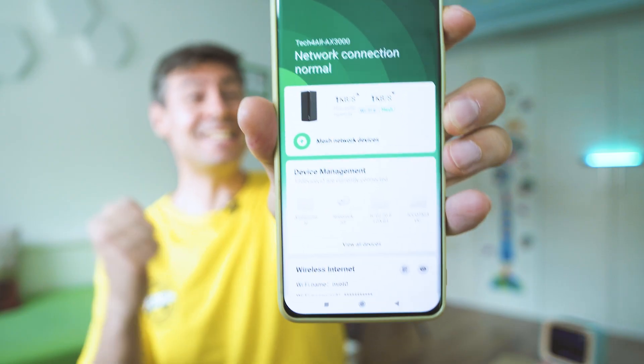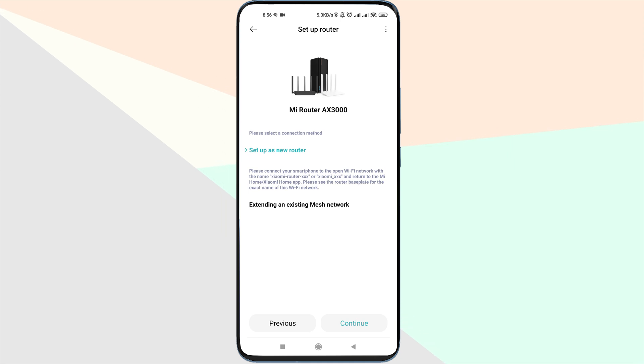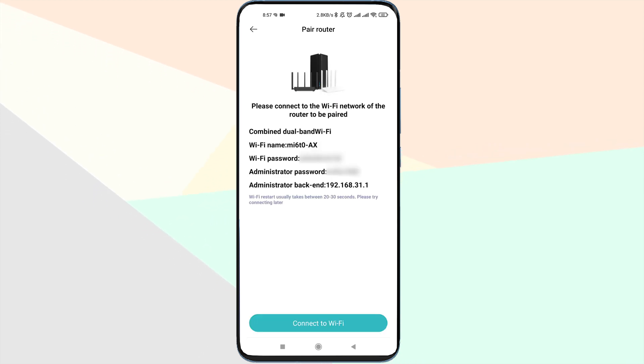Connect to electricity, link the wire where your internet comes from, then start the setup. You can either use a desktop or laptop with a browser, or even better, open the Mi Home app and start setup through the smartphone app. It will automatically detect your ISP's input. If you have wired DHCP input, like in my case, there's literally nothing to configure. Choose setup as a new router, pick the name and password for your home Wi-Fi, follow the guide until the router restarts and applies your settings — and now you can use it. Management can be done from the Mi Home app or a web browser pointed at the router's IP address.